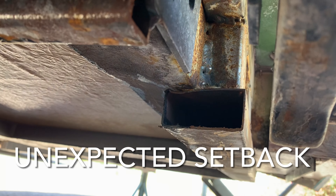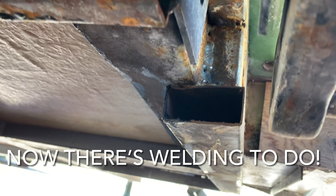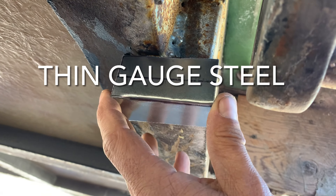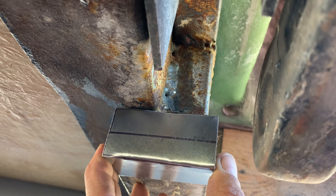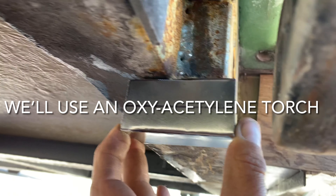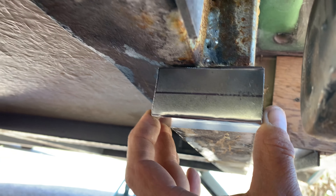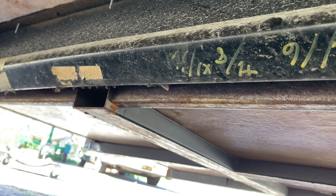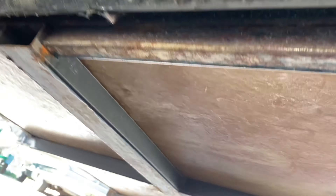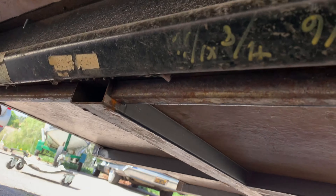Here's a better view - see that? I don't want water and stuff to go into my new frame. So I went ahead and cut some metal and I'm going to weld these little caps over, just like that, to protect the water from going in. I'm going to weld all four sides. And I've got to do it also right here in the center - see that piece right there. So I went ahead and I made a second one, and we're going to weld that piece on right underneath there.